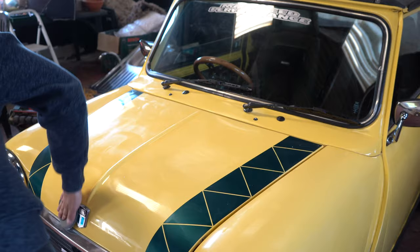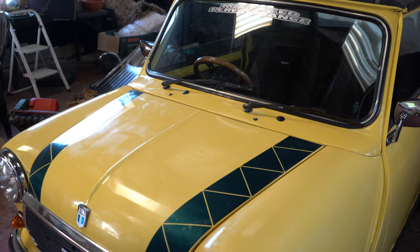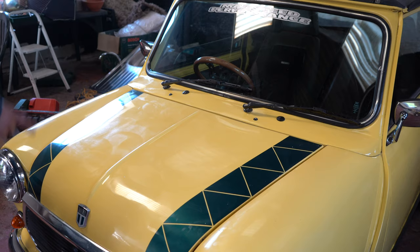There we go, look at that. That's the bonnet done, and just a little touch. You don't want to go too crazy with paste waxes because they do take some getting off. So I'm going to do the rest of the car, and I'll show you how we remove these coatings or sealants or waxes or whatever you want to call them. So as you can see, the entire body's coated, bonnet, sorry, or the hood, if you're from the hood in America. And yeah, we're gonna finish the rest of the car.